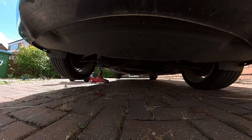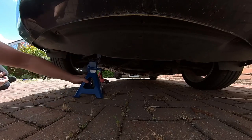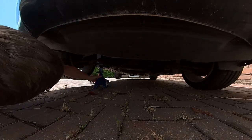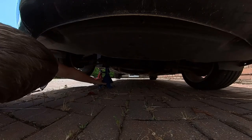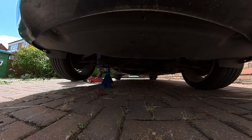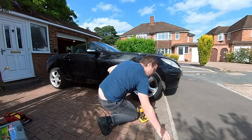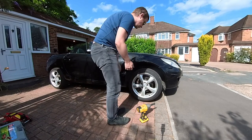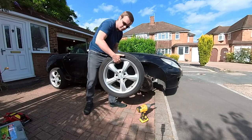With the SLK, I put the axle stands under the suspension pivots. I have seen suggestions of using the bar between the engine mount and the sills, however I've also seen warnings from people who've bent that bar, so I'd be much more comfortable using the suspension pivot. Now that the car is safely raised up at the front, completely undo and remove the bolts from the front wheels. You will probably need to use a special socket for a locking wheel nut for one of them. Keep the wheels safe, you'll need them later.